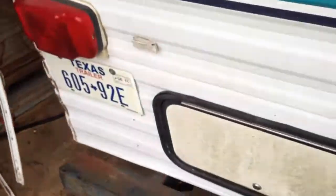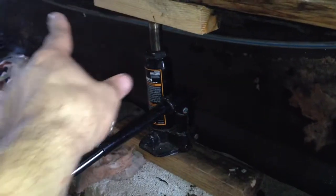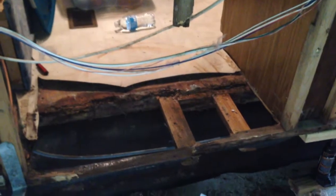I'm just giving this a little more support over here and I'll probably do it on the other side too. It's got this metal frame support here — this is what the joist sits on — and there's one in the front. That's it. It spans this whole distance with no support. So about right where this jack is, I'm going to build another one of these and weld it to the frame, so that midway the joist has something to sit on. That's just to help strengthen it. And I'll probably just go back with regular plywood for the floor.